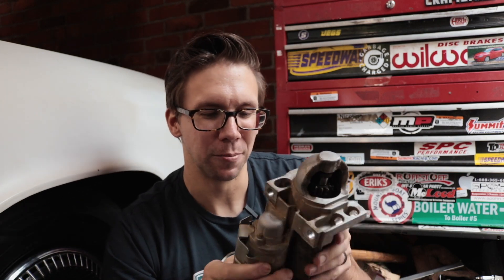When you've got a starter starting to heat soak, it's probably on its way out unless it's a new starter. For the average person, that's how these issues start to pop up. But for performance builds like you and me, when we add headers and other header-related accessories, those issues start to cause problems a lot sooner.